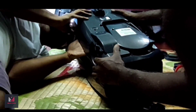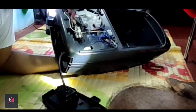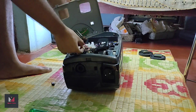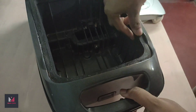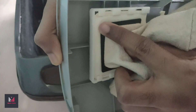Fitting back the sensor calibration knob and closing the bottom lid was a really tough task. After the bottom part was screwed properly, I reconnected all the wires and the back screws and inserted the back panel. Finally, I put back the springs and switches into their places and closed the switch panel. Using a strong rubber adhesive, I put the seal back into place so that no air leaks can form, and checked for any further leaks in the dust bag and the seal — a single crack is enough to cause issues.